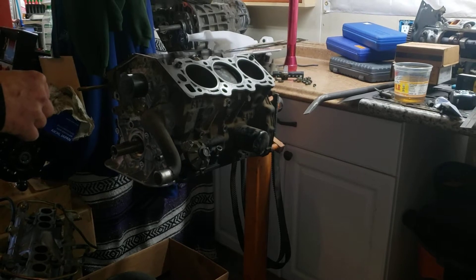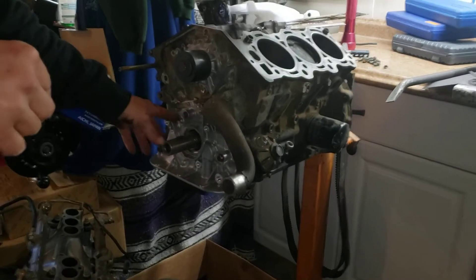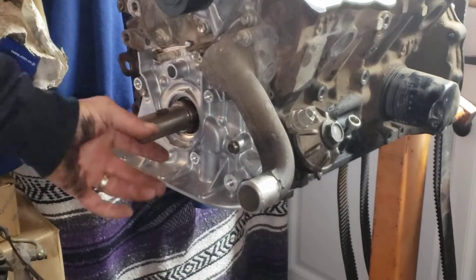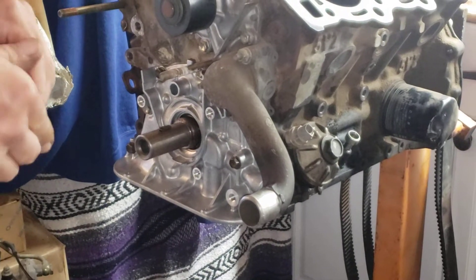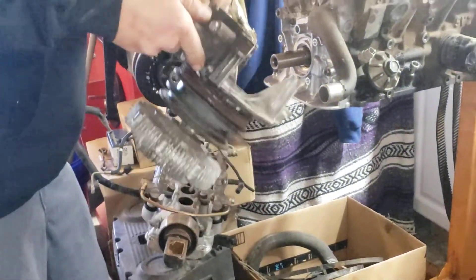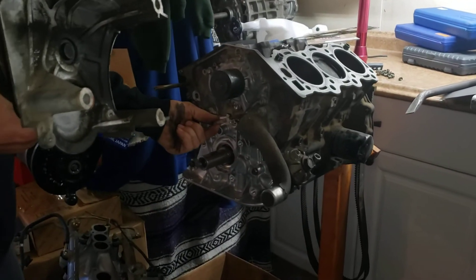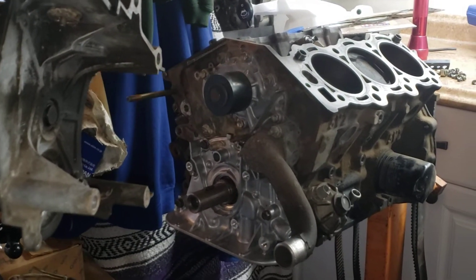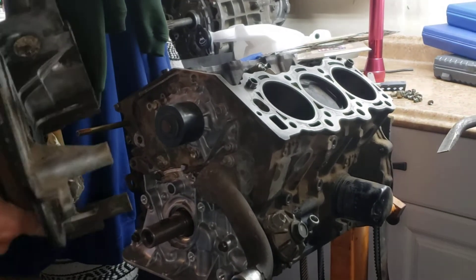Some of the things you'll have to deal with right off the bat is the oil pump. The oil pump's not the same — I went ahead and put a new one on here just because I don't want to mess around with the used one. The timing belt cover does not line up with your 3VZ belt cover and timing belt setup. For the fan support, one of the bolts or studs is in the correct location right off the bat. Toyota drilled and machined the mounting location for the 3VZ setup, so you just take the stud from here and move it to here, and it lines up exactly like it's supposed to.